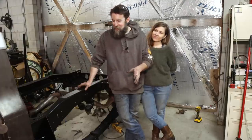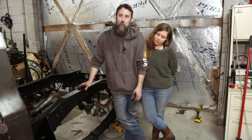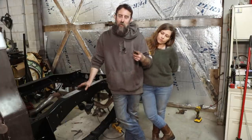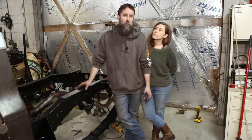All right, guys, that's it. Just a simple video on leaf spring bushings, or any cartridge bushing for that matter. Those ball joint presses are really neat. They're affordable. They're a great way to press these out if you don't own a big press, or don't feel like using an air hammer or burning them out. So there you go. Worked out really well.